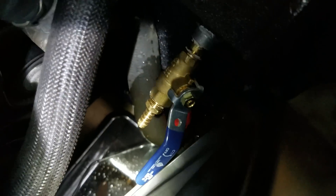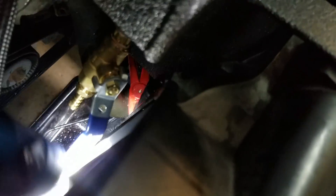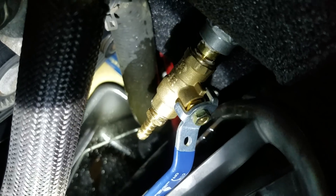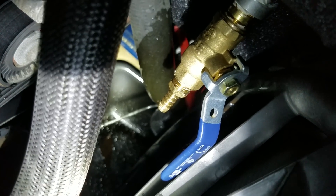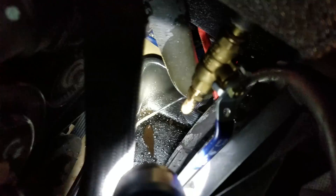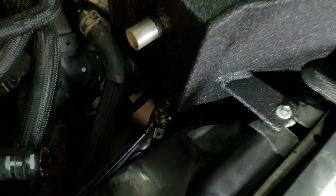I put in the ball valve. It's just a little shield and it opens and closes really easy — that's the main thing. You want to be able to get to it easily, drain it. I used a ball valve — quarter inch to quarter inch ball valve to a quarter inch barb. So I can put a hose at the end and run it all the way to the bottom so I don't splash water all over the place and potentially get water on my front accessories while driving up to the line.